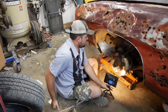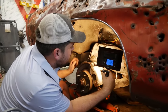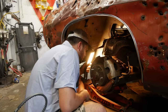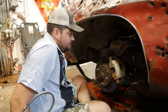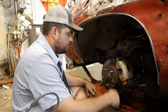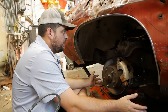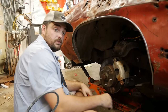It still has its original ball joints and bushings. I'm just going to take a peek at the bushings — I can see some cracking, but I don't see anything that looks like they've been walking around. The ball joint boots are in good shape and still have grease in them. They're tight. I think I'm going to leave them alone — they're probably better than the Chinese ones I got for it. Everything feels great up here. I just wanted to make sure it would be okay for a high-speed pass down a quarter mile strip — this thing will probably hit 90 to 95 miles an hour by the end of the strip.